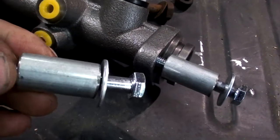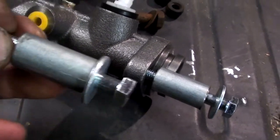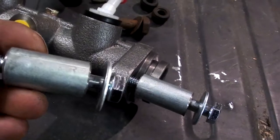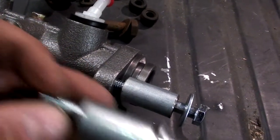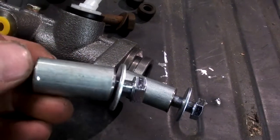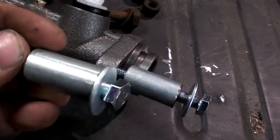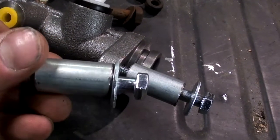You can get a kit to do this, but you need a spacer because the Napoleon hat section of the firewall is kind of hollow. If you were to just bolt straight through it, it would just crush down. So you have a spacer in between. I just got some pipe and cut it to length - they should work.